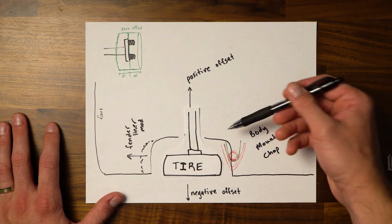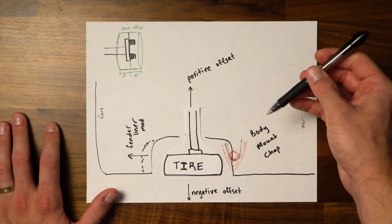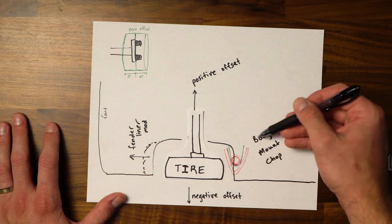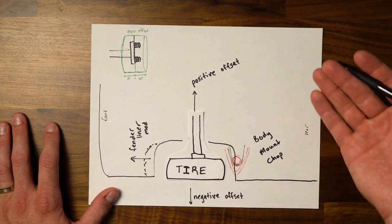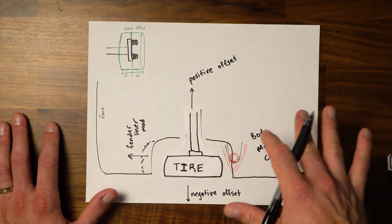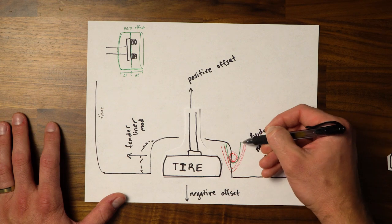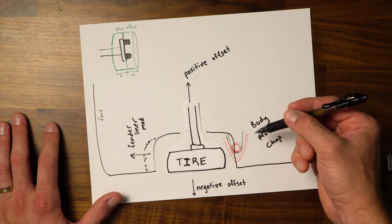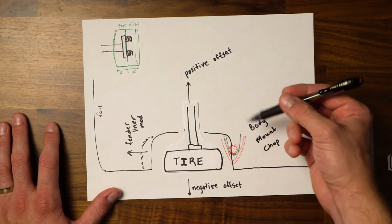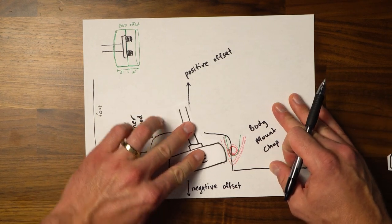Now, a body mount chop, what it basically does is your frame mounts to your body in certain spots. And so this body mount is pretty large and there's extra metal around the mounting location. Now, some people will argue this is for additional safety or additional stability, and so they don't recommend a body mount chop. You're gonna need to go with whatever you decide and do some of your own research. But what a body mount chop does is it cleans up maybe some of that extra metal around that body mount and puts a very aggressive new welded reinforcement around that body mount. And so you get a little bit more clearance when you're turning your tire past there. It won't rub as bad.